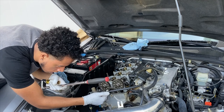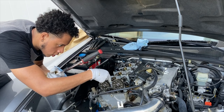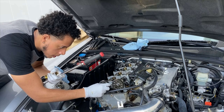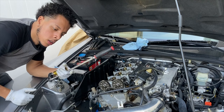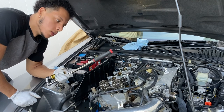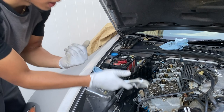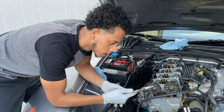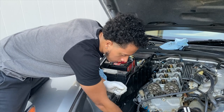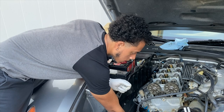There's also gonna be a mark here on the crank gear — it's supposed to come up straight. And these two cam gears, the little notches are supposed to face each other — that's when you know cylinder one is at top dead center. For the crank bolt, it's a 19 millimeter. I don't have a 19 so I'm using an adjustable, but you can use that too. You want to turn it clockwise.